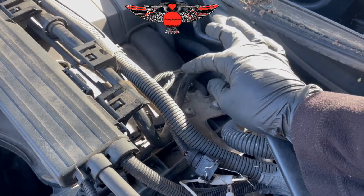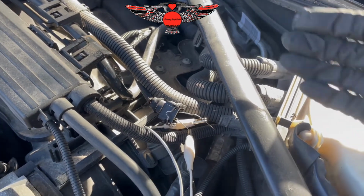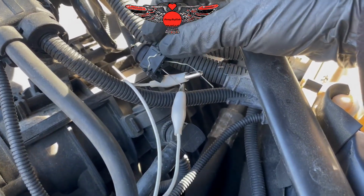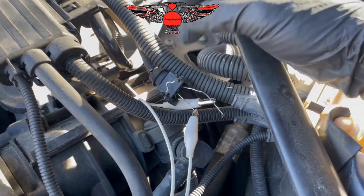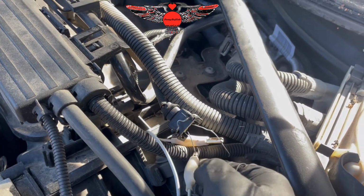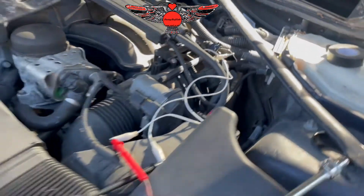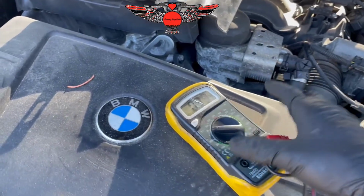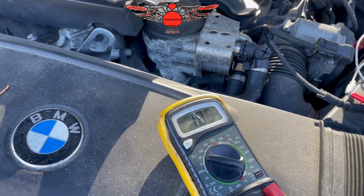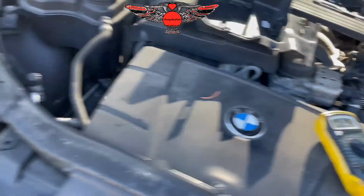So definitely check your wiring if you're checking this kind of fault. Now, assuming my wiring was okay, I plugged these paper clips into that plug. Just make sure they don't touch each other. And I'm going to operate the valve from the software, and then we can see if we have any voltage here. At the moment this is fluctuating a little bit, but I do have a bit of a dodgy meter here. Well, let's have a look. I'm expecting there to be around 12 volts.